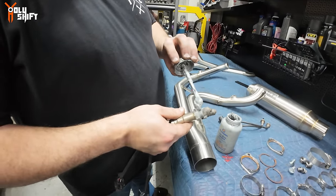So yeah, even loosening this wasn't enough. We can't push it forward enough. So we're loosening up the pipe, the exhaust right here, the pipe mounts over here. Loosen it up, play around, wiggle it, and it's locked. Perfect. In the current position, when it's all situated, we'll tighten everything up. A little bit of play with the final position to get it aligned. It was simply that the bag wasn't moving forward enough to lock in place. We're done, now we're going to roll it into the dyno station and tune the bike.